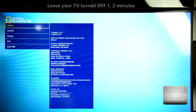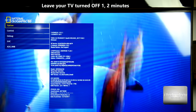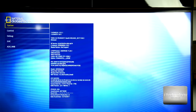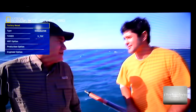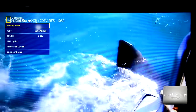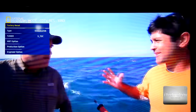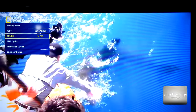You will see that it's necessary for the Samsung logo to appear. If your TV starts up without the Samsung logo, you will not get into the secret menu. The trick is to leave your TV off for one to two minutes and use a normal button remote control. Now, in the options we have factory reset — be careful, I don't think this will reset the model code, and I don't think factory reset will restore the changes you made to the TV.